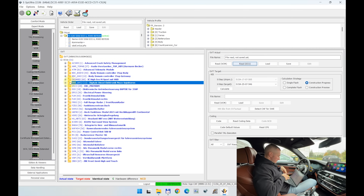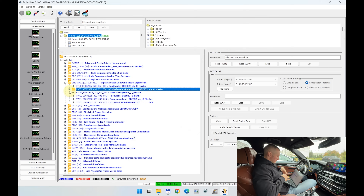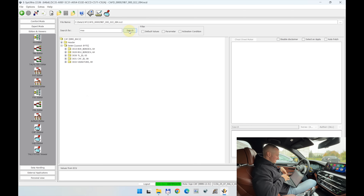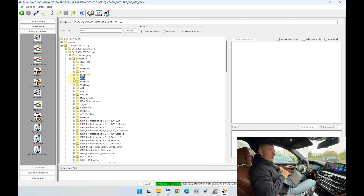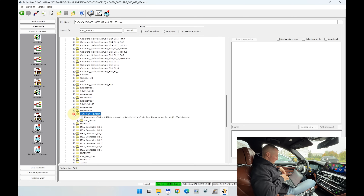Here is the method to make it work with memory, so if you press it on or off it will remain in that state as you prefer. The principle is the same — go inside the engine ECU, press Read Coding Data, go inside the coding file. The same MSA parameter is here, and you can disable it the same way as on the previous car. But then you will have all the same circumstances — an error present in diagnostics — that's why we need the parameter called MSA Memory.